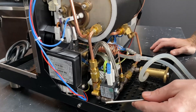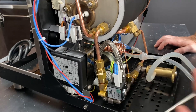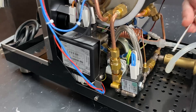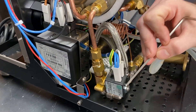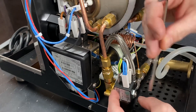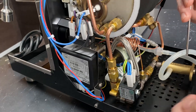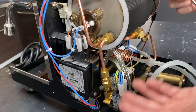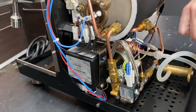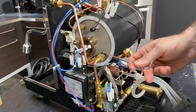It's just a little extra added safety. The solenoid should keep most of it from coming back, but better to be safe than sorry. That solenoid valve, for anybody who doesn't know, is kind of like a magnetically operated valve — it charges up a coil in there to open that. When it gets power, it charges the coil, and there's a little piston inside the valve that runs through it, and it just pulls that forward, or up, whichever direction the thing's facing — it allows the water to run through the system. So up here goes through this copper line and into the boiler itself.